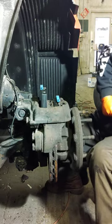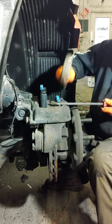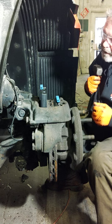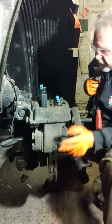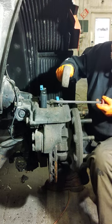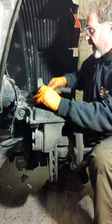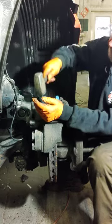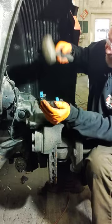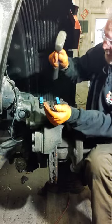Get it close, and then lay the bar across the top of it. Give it a few more taps just to let it sit home. You can see it round off at the top of that rotor. If there's anything on the outside of the rotor that buggers up, just take a little grinding wheel and clean it back - that'll get it to sit home so the rotor still rolls. Do the same thing with the back side. Stay away from hitting that spring clip because if it pops off in there, it's going to be a bugger to get it back on.